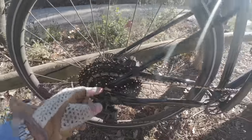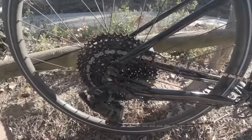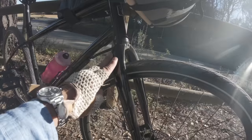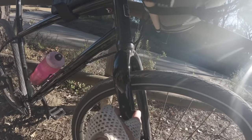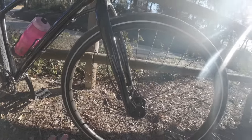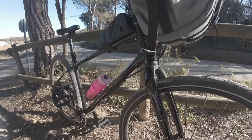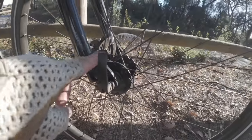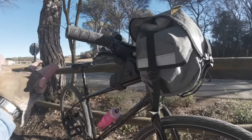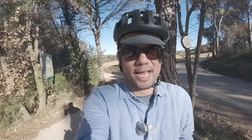Check out this massive tire clearance — it comes stock with 700 by 40s, but it's an interesting spec because it's spec'd out like a commuter bike, yet you can definitely put way fatter meats here. It's got a bunch of utility rack mounts, fender mounts, and the drivetrain is Advent X — I could always do with lower gears, but if you ride it generally unloaded and not in super mountainous territory you should be good to go. The fork is all steel with really thick bladed steel fork blades, mounting points for a water bottle cage or front rack. More gusseting on the head tube — it's made to be a really durable and chunky bike. This build has hydraulic disc brakes. People are going to kvetch about quick release instead of through-axle, but I don't think that's a big deal for this price point. Handlebars are flat; I'd personally prefer a little more sweepback, but that's the bike so far.